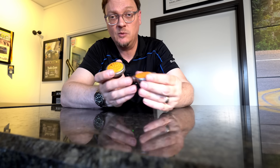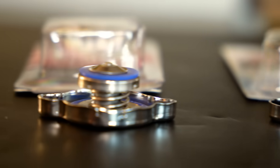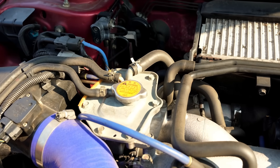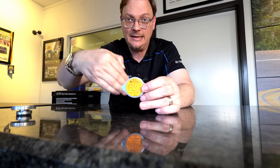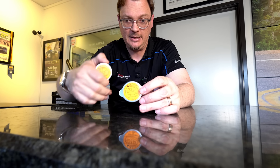The first point of discussion is one-way caps versus two-way caps. Almost every aftermarket radiator cap that you're going to find is a two-way cap, because most cars have only a single radiator cap, and in that case you have to have a two-way cap. What does it mean for a radiator cap to be a two-way cap? It means it can let coolant out and it can pull coolant back in. A one-way cap only has a single valve and it can only let coolant out — it cannot let coolant back in.